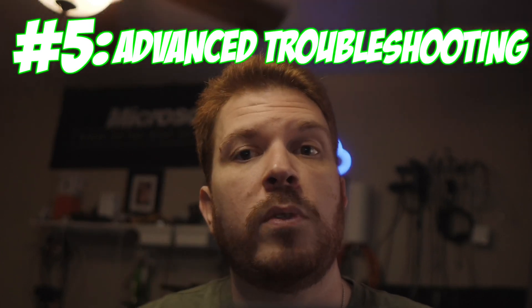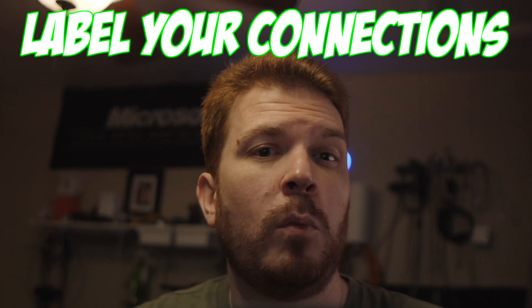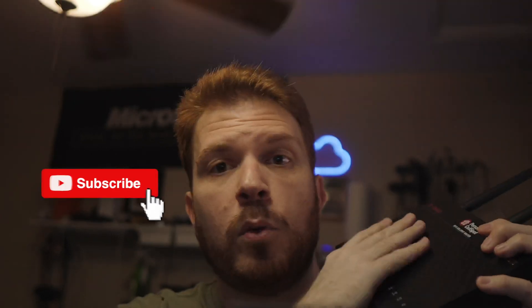Number five: if you're still experiencing issues, we'll break it down further. Does the Wi-Fi have problems even in the same room, or do clients connected via ethernet have problems, or both? If it's Wi-Fi, it could be anything from a failing Wi-Fi card to interference or overheating because the router is buried inside a cabinet. If it's in a cabinet, take it out, leave it unplugged to cool down, run all cables and power outside the cabinet, then plug everything back in. You may also want to label everything. After it cools down, if Wi-Fi only has problems, it could be the wireless card going bad or already dead — you can determine this if all wireless clients are unable to connect or the SSID isn't showing up at all.